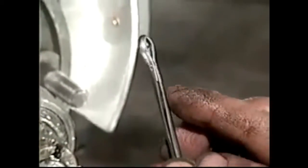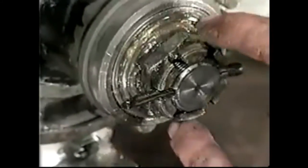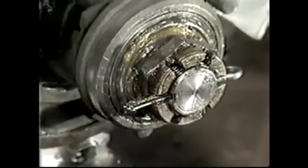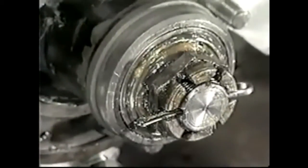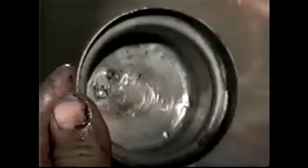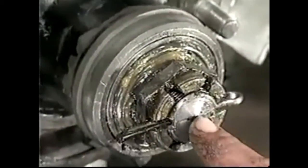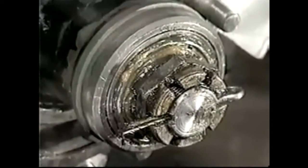We've got the cotter pin or split pin. You can see I've twisted this split pin, and the reason for doing that is when we put it into the hole, it allows the legs to come back around. Inside the dust cover, there's a static electricity grounding arrangement, and you can see that somebody's taken this one off, and that's because they bend the lock tab, or the split pin I should say, back on itself and that causes that to break off, and that's what's happened there.